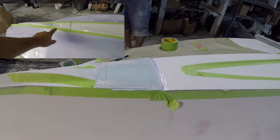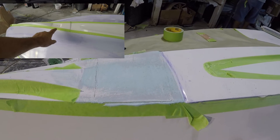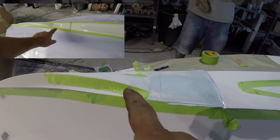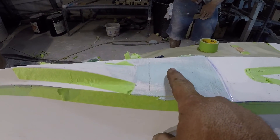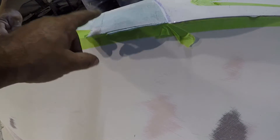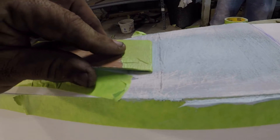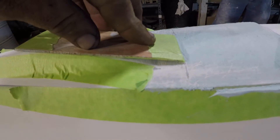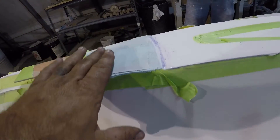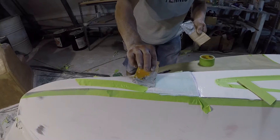Here we're doing the modifications you've seen in previous videos. There was a hole made for a light, but unfortunately we can't get a light that fits, so now we want to make this area blend in. We're going to shave this to make it blend with that surface so it follows through, and the space that needs to be filled — once it's filled, we make this land flush with that.